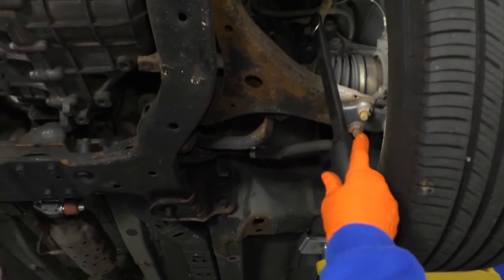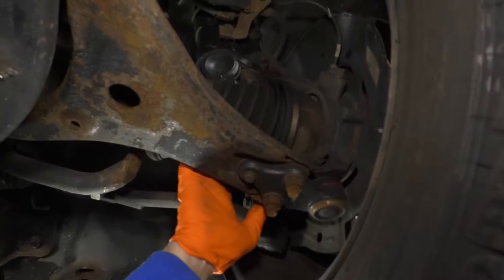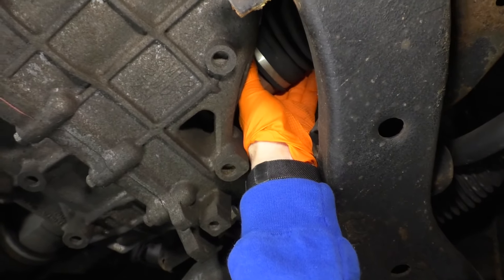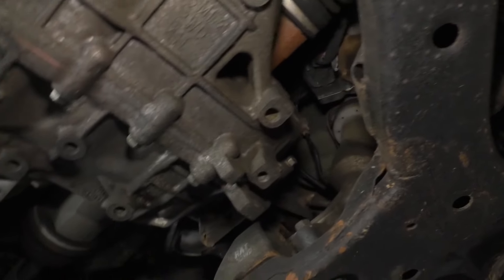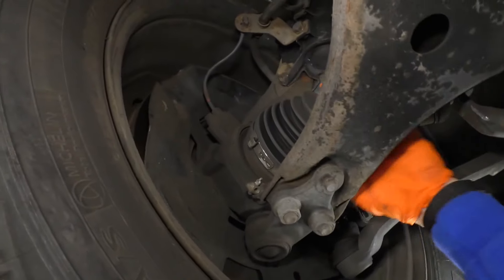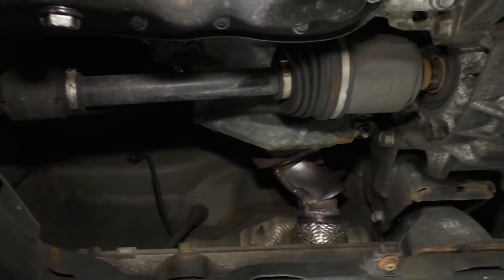I'm going to check for CV axle play on the outside here — grab it, and that's still tight. That means the axle nut's tight. I've got no tear in the boots, so that's in place. I'm going to follow that shaft right into the transmission and grab it — that's normal play, just a little bit of rocking back and forth. Then I'm going to go over to this side. I've already checked my tie rod ends and ball joint, so I'm going right to the axle. No tears, that's good, no signs of grease anywhere. Following the shaft up — and there's the problem.